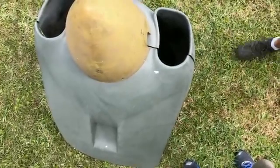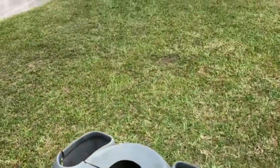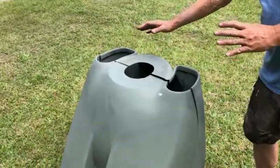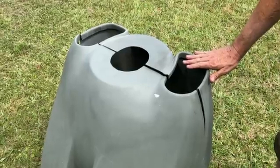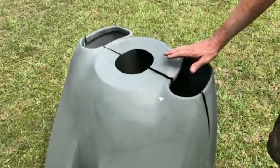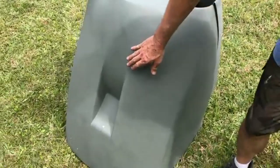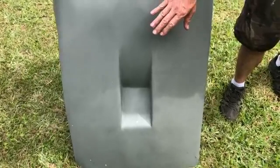If you look at it, it's set up for a 13-inch spinner that could be used for the Warp Drive or another propeller. It has very large inlets, but instead of these being set up as J3 eyebrows, this is a full-pressure cowling that is designed to use all of our baffling kits. It is organized — fiberglass all the way back. It has an air inlet for a standard carb location on one of our intake manifolds.